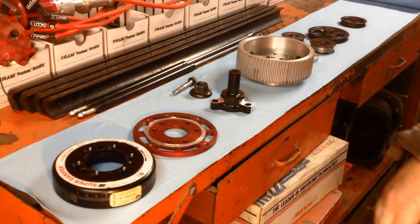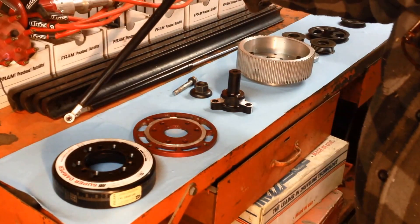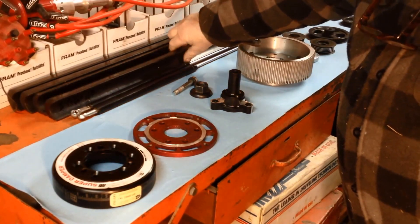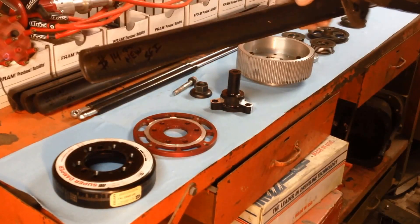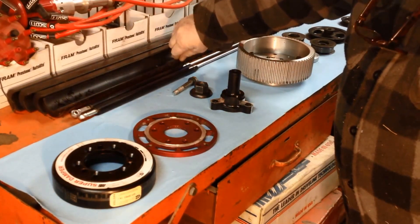Here's some of the goodies that I picked up at Second Chance Race Parts. Got a nice pair of nitrogen cylinders that have real nice rod ends on them — I'm going to use those to hold the trunk lid up. I also got a deal on some SFI spec 45.1 spec roll bar padding from around the helmet area, which is a requirement, so I got that on there.